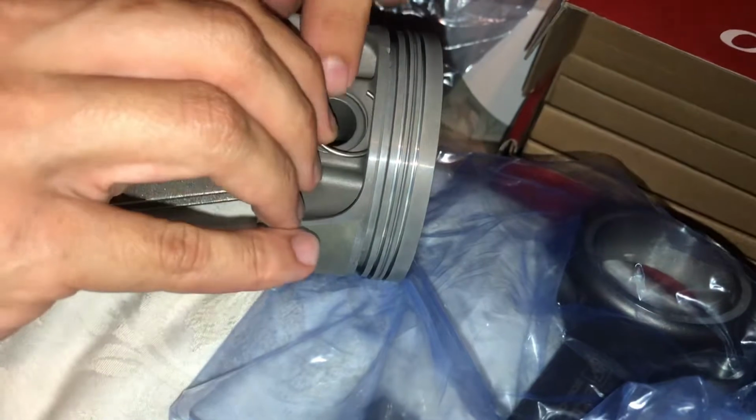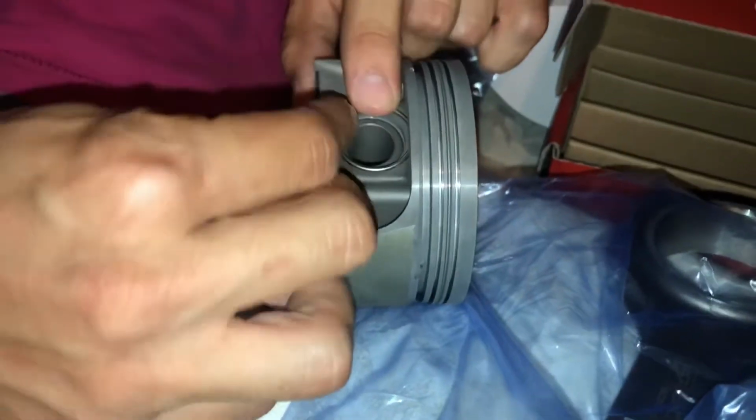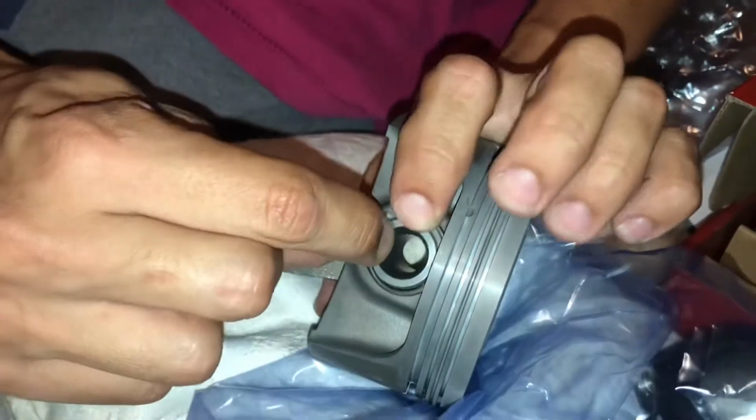So we do the same deal. We get our last snap ring, and we position our tangs right there against that little groove. Put it in there, and then same thing. You just hold tension with your pointer finger on this part, right up here. If we could get it in the groove there. There we go. And yeah, there. Oh, popped out again. Hey, it's not trying. But you get the idea. You just rest it inside of the groove here, and then you use the piston to actually pry up against and get it into the actual groove.